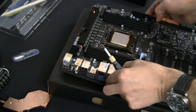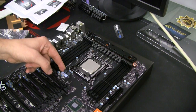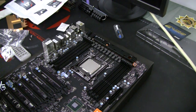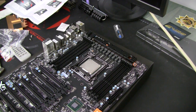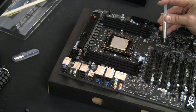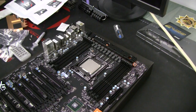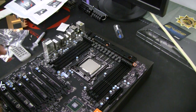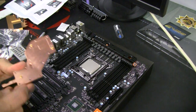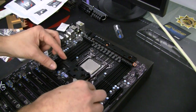As you can see, it wasn't that difficult at all. The last part we need to install is the final block. I have the thermal pad in place and all I need is to add a little bit of thermal paste - the one supplied with the block - but I have my MX4 that I just used here, and it should work fine. This part will be a little bit more tricky because you put the block on top and then you should carefully flip the board and put all three screws in place. Again, watch for motherboard bending.